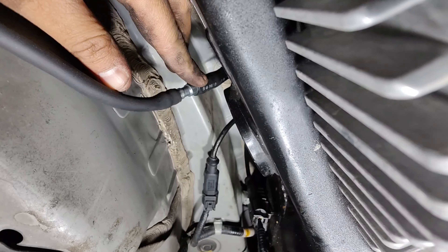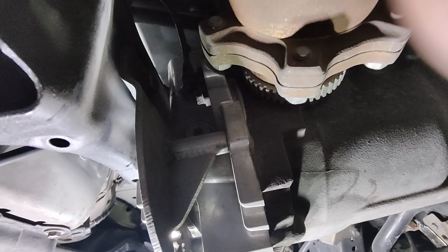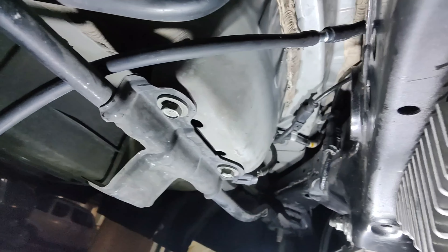I got the hose right here. I had to cut it off the breather that goes over there, and I put the adapter I just bought with the new hose. Now I'm running it through the bottom over here and guiding it all the way into that hole. The fitting with the hose starts right there on the top of the differential. Now I'm going to run it into the trunk and get the oil catch can.